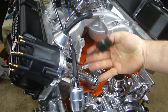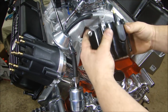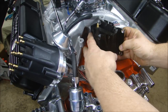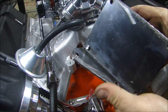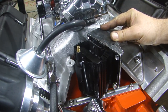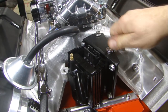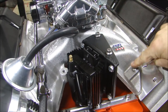First things first with the ignition: the distributor has a Pertronix unit inside, which means I have the coil for the Pertronix unit and I have to mount it somehow. I'll make some sort of bracket. I got this bracket with threaded holes in the bottom — just welded this angle up to match the shape of the manifold. It fits right in here nice and easy. I'll powder coat it black. I've got some nice 12-point bolts so it matches the intake manifold. Coil is mounted.